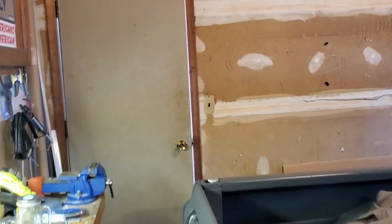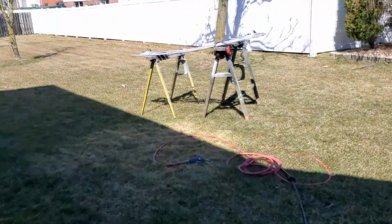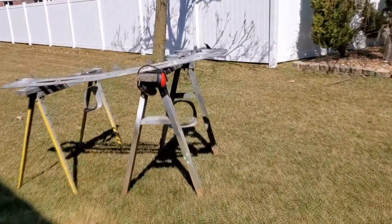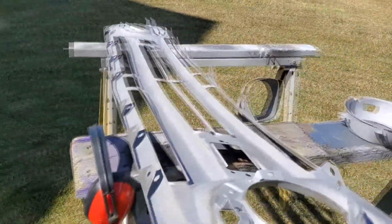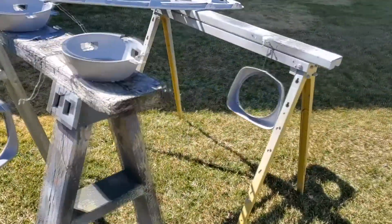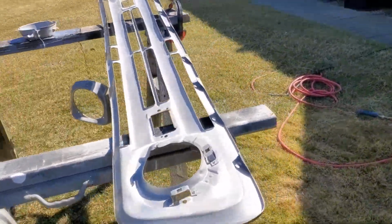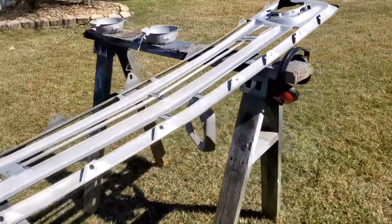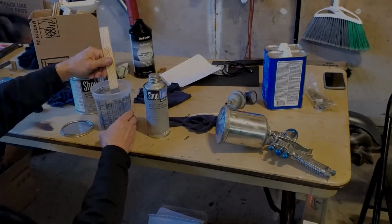All right, so let's head outside and on to the real reason why I'm over here today, and that is to work on the grill. It was missing a bunch of fasteners, and I kind of wanted to paint it the same color as the bumper, so we had the whole grill here sandblasted, the headlight buckets, the headlight bezels, and I think I'm going to throw some primer on the new kick panels for the interior. It's bare metal here, so I'm going to put some sealer on it and some slick sand right out here and get it going.